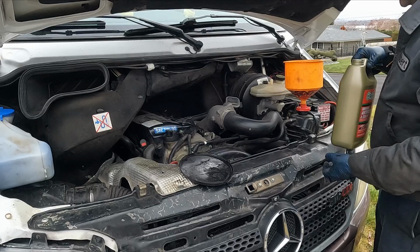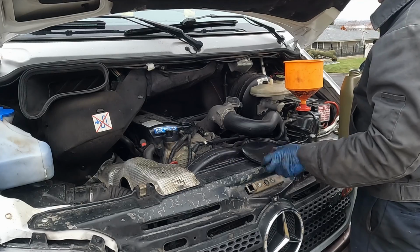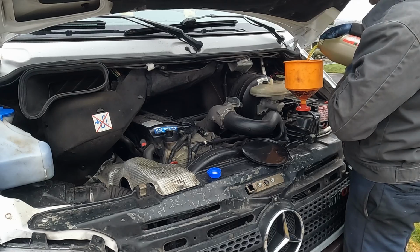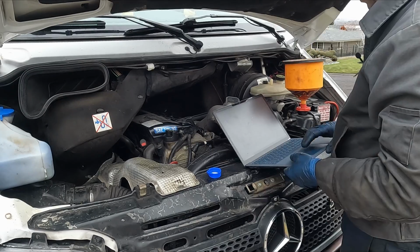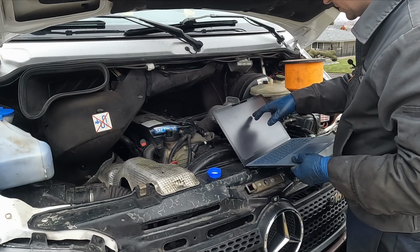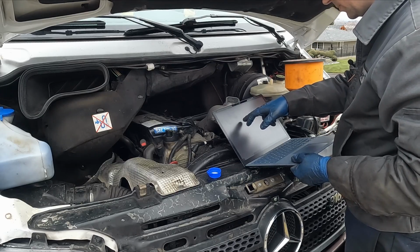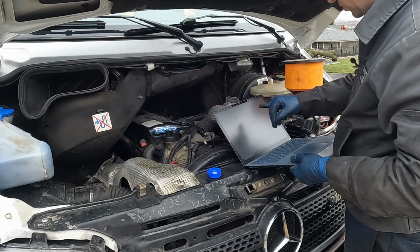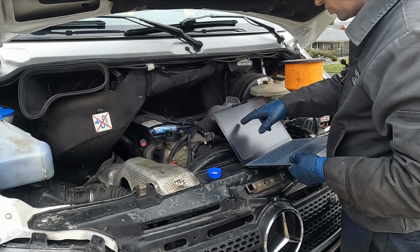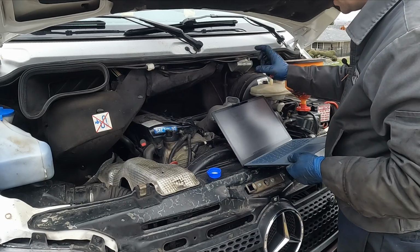So this is the 2nd gallon going in. Want to be careful not to spill any on our new serpentine belt. Okay, let me just read you what it says. We want to fill this up. It says fill radiator to top and add sufficient coolant to the coolant recovery pressure container to raise level to cold minimum mark. So wherever that is in here. Cold minimum with heater control turned on to the hot position. So we want it totally hot.